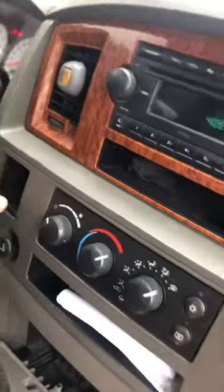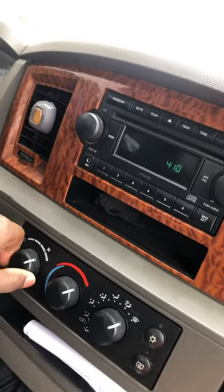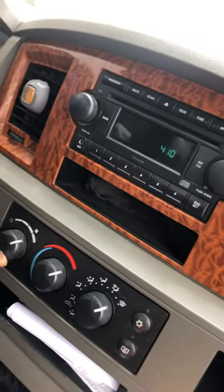What you can do is turn your control panel on with the vehicle on, and then just give the blower motor a couple of taps. Start it going again — if it's blowing on low, high, or any setting after tapping it, that confirms the motor is the issue.